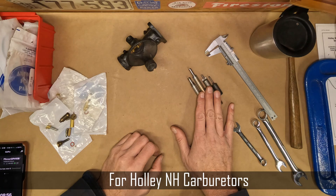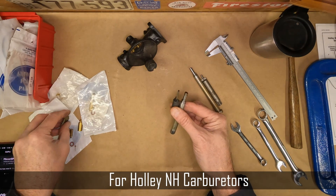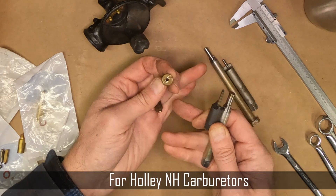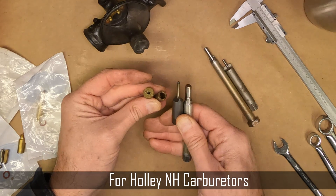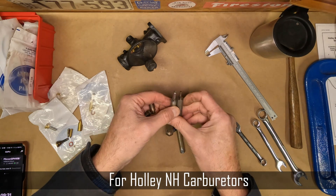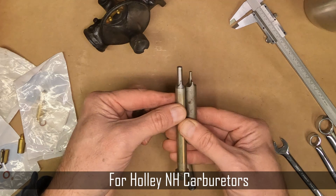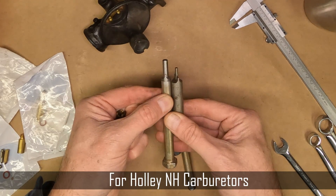So you might wonder why I've got four of them here. I've actually got two that are fitted to mangled old parts, so they've got wider tangs on them to fit the mangled wider slots on these old seats. That gives these maximum width and strength. And I've got another set that are sized to brand new parts, so they have much narrower tangs — not quite as strong, so I don't like to use these for extracting. They probably work just fine but you do run the risk of breaking the tangs off, depending on what material you made these out of.